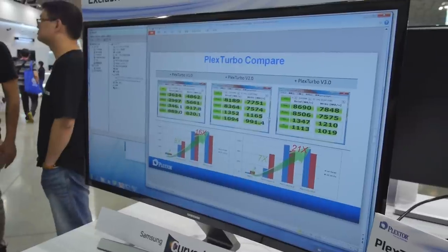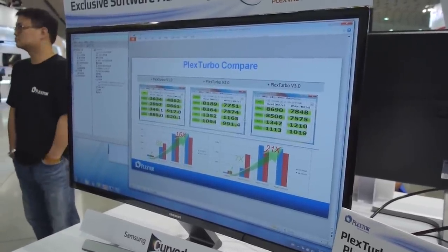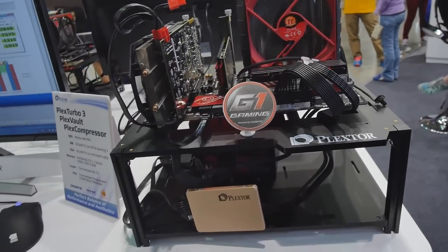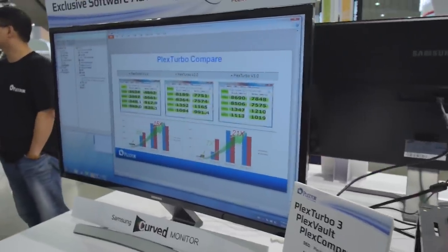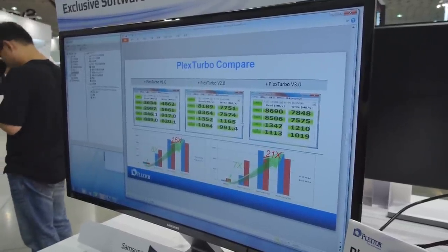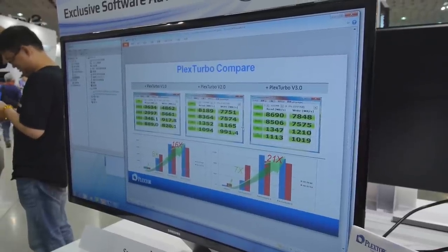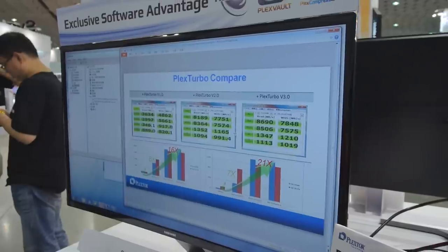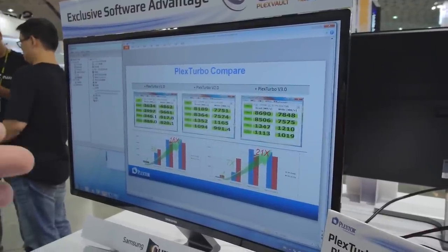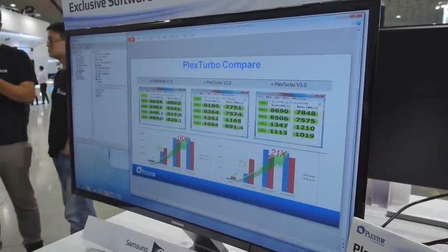They're showing software called Plex Turbo. It's kind of like a RAM disk, but it's not really a RAM disk at all — it's more intelligent. They're looking at what's on the disk and during a file write operation they're only writing what has changed. So if you're downloading a patch for a game that's several gigabytes and it's got to update multi-gigabyte data files, instead of writing the whole file, the software looks at what is to be written versus what's already on disk and only writes the changed parts. So a five-gigabyte file where the patch only modifies a few hundred megs means only those few hundred megs are actually written. You also get crazy benchmark numbers because the benchmark writes the same file repeatedly, so it doesn't actually need to write to disk at all.